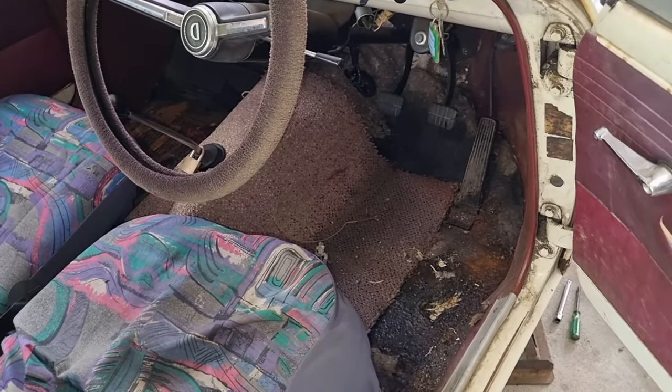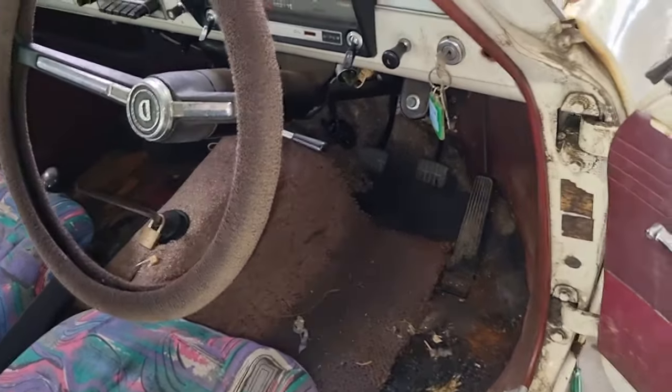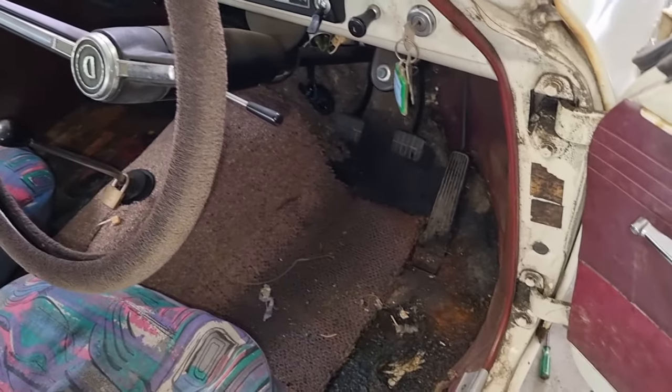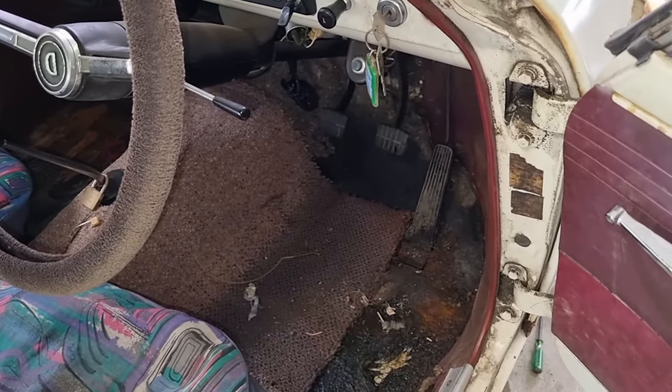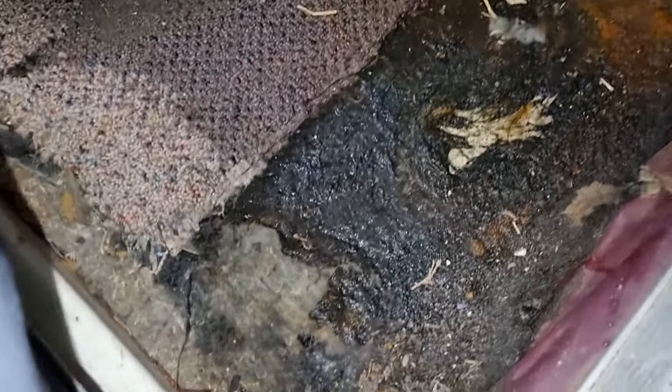The bolt underneath the mudguard, when I go to turn it, it just seems to be spinning. So either there's a captured nut that is no longer captive, or it's just rusted out or something else. So I'm coming to the inside and pulling the carpet. I'm going to throw all this stuff away anyway, but it's probably good that I'm working on this at the moment because this thing is saturated inside.